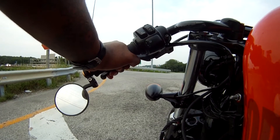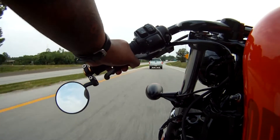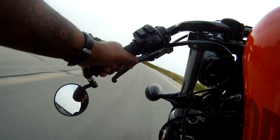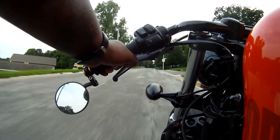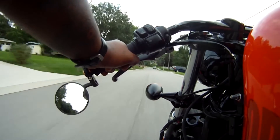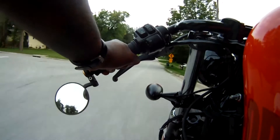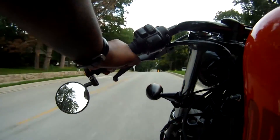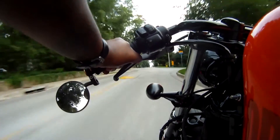Just got the thumbs up from somebody who likes the way the bike looks - he doesn't know I almost died trying to get into my driveway. I can really hang off the bike with these handlebars though. I really have to adjust the angle of these pegs - I cannot get my feet off of them. And then when I do, I still can't initiate a gear shift. I bet the bottom of my boots look like axe murder right now. They definitely stay in place - that's what I was looking for. The bike feels really agile. It's funny because I had to raise the triple up over the forks, so the front of the bike is actually higher than it was yesterday. I thought that would have slowed the steering down, but with all my weight so far over the front, it had the opposite effect. Now I'm starting to feel it in my back.